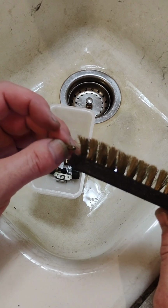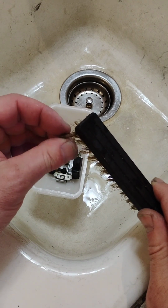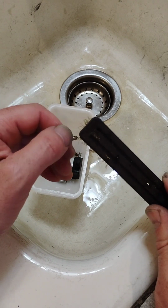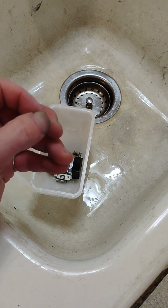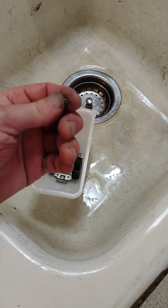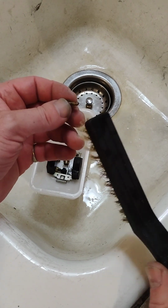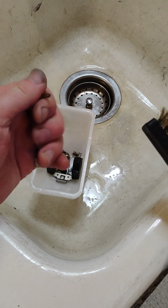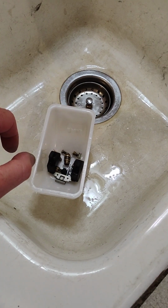And I'm just pointing this out because I had a heck of a time working these wires into those holes. In fact, I couldn't for quite a while. I had to really scrub and press and clean it out. So just really pay attention to these little microscopic holes, and don't go at it with something ginormous. Use a really delicate piece of wire like this so that you don't ream out the hole or do something to change the actual jetting of the carburetor.